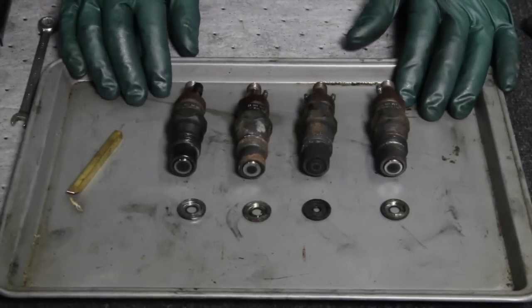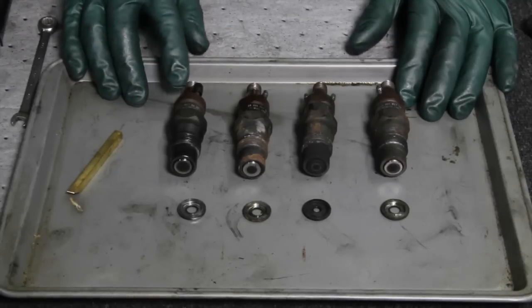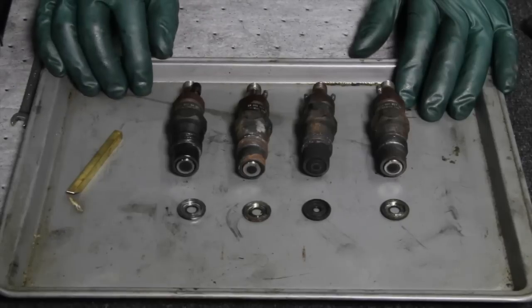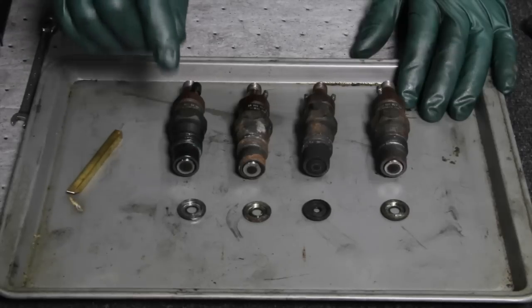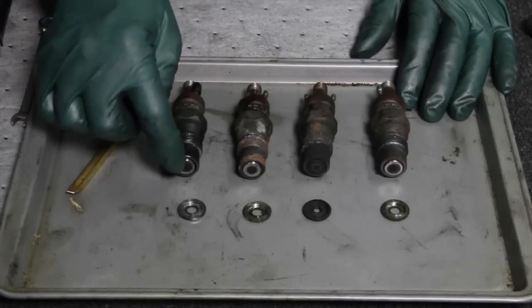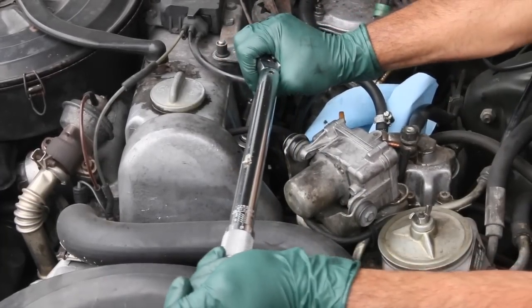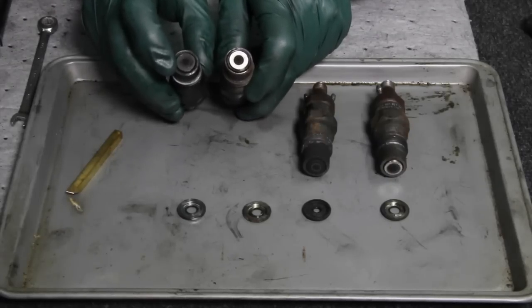So take a look — they're a little rusty, they've been sitting in the car for a while. But a couple of things that are very important to note: number one, it took an extreme amount of torque to remove them. These injectors were over-tightened, and I harp on this all the time. If you over-tighten these injectors, you're going to put excessive pressure on the nozzle and it can actually hang up in there — that's one of the things that causes nailing or rattling. I've seen these tightened so much that the injector nozzles will actually overheat. They need to be torqued properly and you need to use a torque wrench.